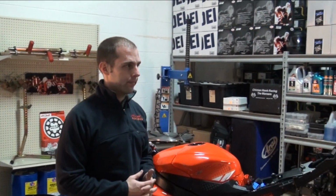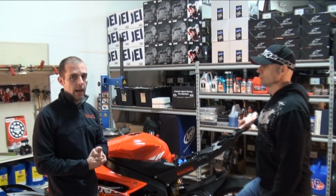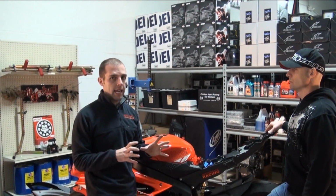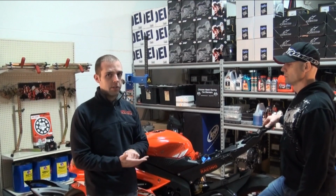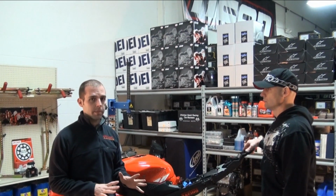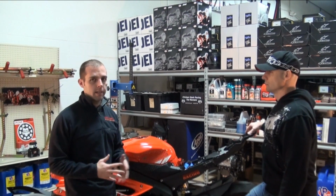Right. Constantly. Yep. All you have to do, it has a safety feature where it doesn't do it on the fly. So you would come in, you would set it to, okay, let's scan the air fuel, and come back in, hook up the laptop, accept the values, and go back out, and you're set. You could do that every time you go out if you're really picky. I've just done it a couple times just to make sure it's in the right range, and leave it at that.